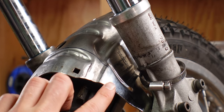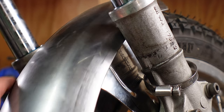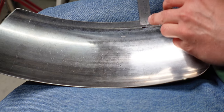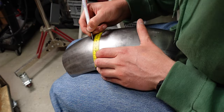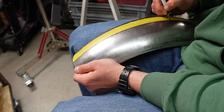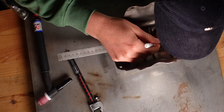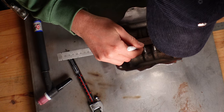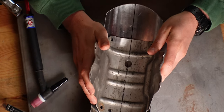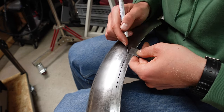The fork stabilizer has three steps in here and I would like the fender to end with this step, so I need to figure out how to measure that distance. If I measure from here to there, that is 10mm — that gives me a good estimate of how much I need to cut away. Next, I need to determine the center line. I'm going to transfer that to the inside. These two center lines will help me align the two pieces for the right fitment. Now I'm going to measure 12mm from the side, and that's going to be what we cut away.